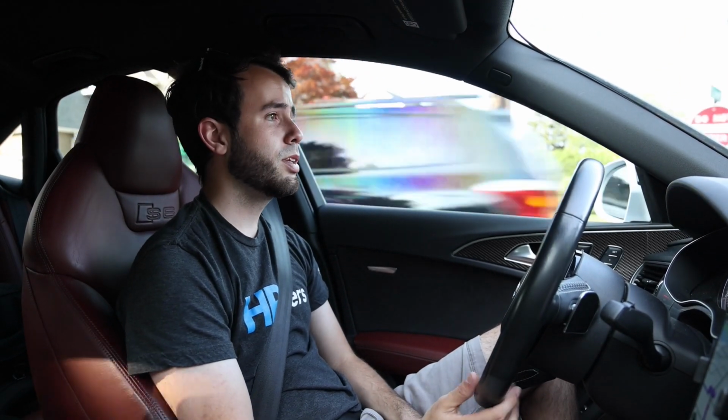I don't know beyond stage one, I actually haven't asked about this, if you'll still be able to run E85 without at least high pressure fuel pump internals. And obviously, if you do get high pressure fuel pump internals, it's not going to hurt you if you're running stage one. It's just going to allow the car to supply more fuel. But obviously, if you just want a stage one car and just want to put ethanol in it, that's totally fair game on the integrated engineering tune.